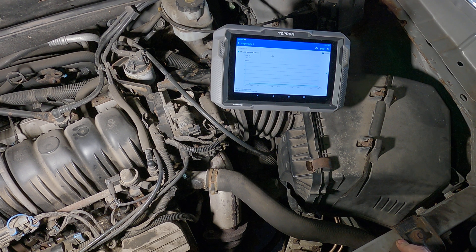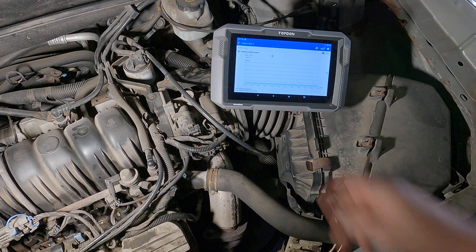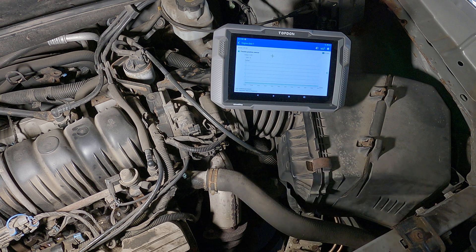That's a quick, easy way to go through a three-wire sensor. The throttle position sensor works pretty similar to the MAP sensor or the mass airflow sensor on this vehicle, so all three can be tested the same way to verify circuitry. We know we have a bad part if we have everything in the circuit we need — a sensor feed, a sensor ground — and we can short the feed to the signal wire and cause the voltage to read high. We can see it on the scan tool, so I don't need to get out a scope or any other test equipment. A paper clip is good enough for this test.